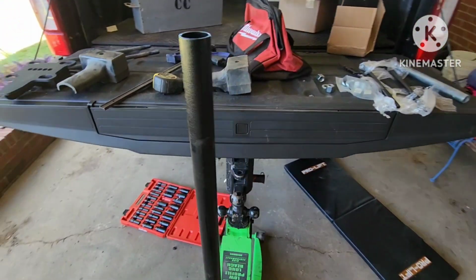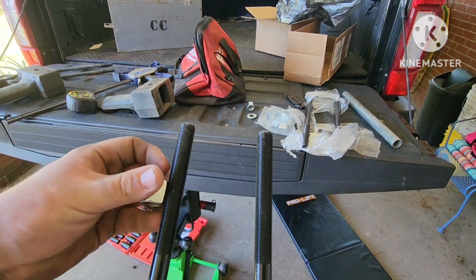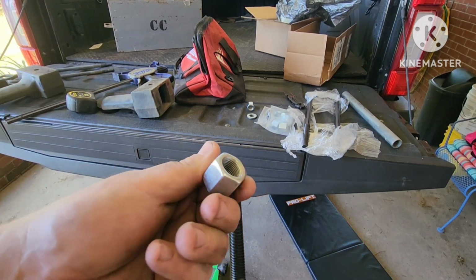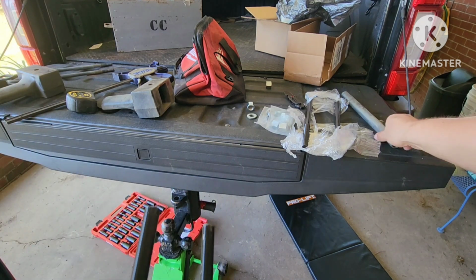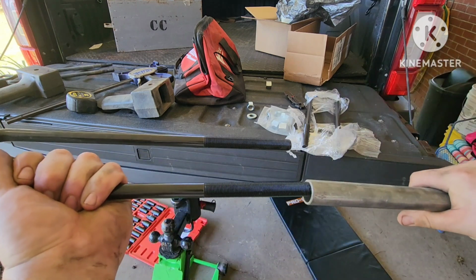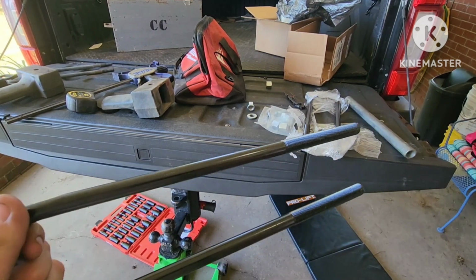So, I come over here and I'll get a bolt. And I'll get this bolt and I'll run them to about here on both sides. Because you're going to mess up the threads a little bit, and at least when you take the nut off, it fixes the threads on the way out. Then what I do is once I have the bolt on, I go and put this pipe over it and I bend it so I can open up this channel back again, because that's the only way you can get these things on.